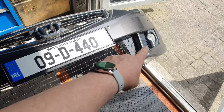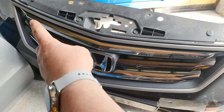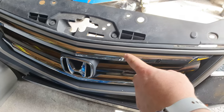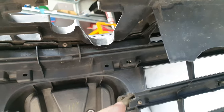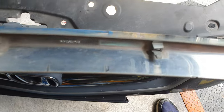If you're wondering how to remove these chrome pieces to tint them: at the back you'll see there are screws that hold it in, plus some clips. There are screws in a few places — basically you just take off two screws and those clips and it comes off. You can see the clips at the back and where the screws go.